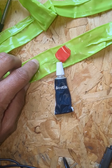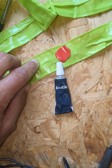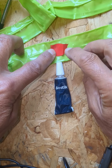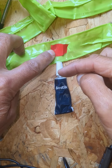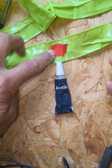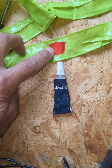So that's how I approach repairing my TPU tubes. First of all, I try not to repair them by the side of the road if I can help it. When you get back, find the hole, cut yourself a piece of old TPU inner tube and use that as a patch. I find sticking it on with this Bostik soft plastic glue works for me. However, other people tell me that other types of glue also work.